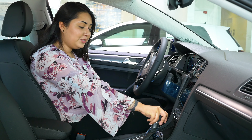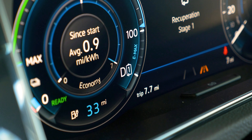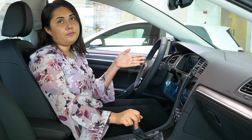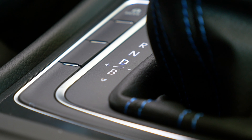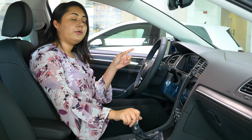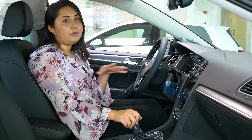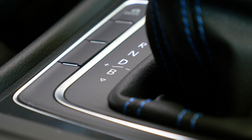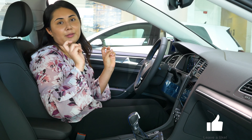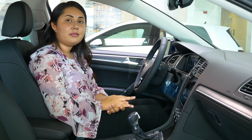To get into the regenerative modes, put the car into drive and tap to the left — it goes into recuperation stage one. Tap left again for stage two, which you'll also see on the infotainment cluster. Tap left once more for stage three. To go back down, tap to the right and it'll go from three to two to one. For regenerative mode B, the most aggressive mode, you can't access it the same way — instead, push down like a semi-manual car, tapping down to what you'd consider sport mode. That's B mode, the most aggressive driving mode available on the e-Golf.